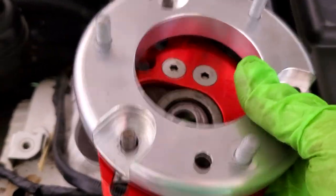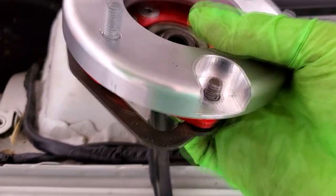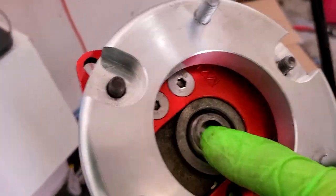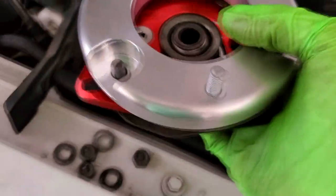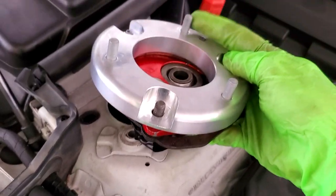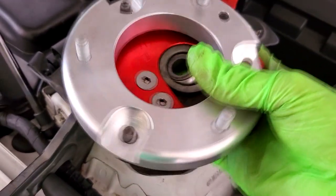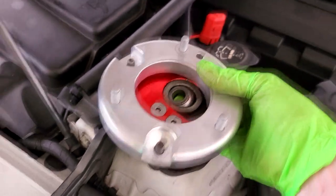If you put it in flipped, your negative camber becomes your positive camber, and while there is some negative adjustment, it's not nearly enough — it just doesn't work no matter how you orient it. My solution is to take the driver's side Vorschlag camber plate — and I'm assuming this works for TC Klein, KW, and the rest — and bring it over to the passenger side and flip it around backwards. By doing so, the ride height spacer bolts into the strut tower, those studs line up, and your plate now slides inward giving you the correct amount of negative camber without messing with your caster.